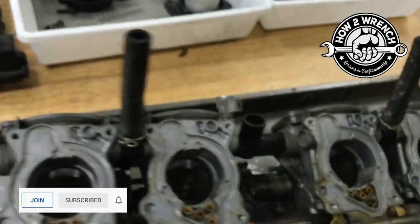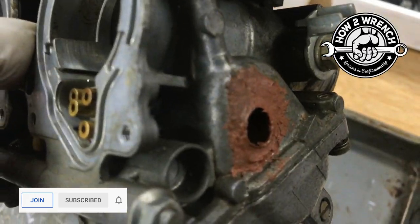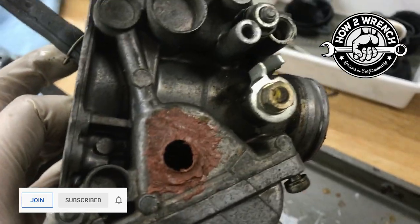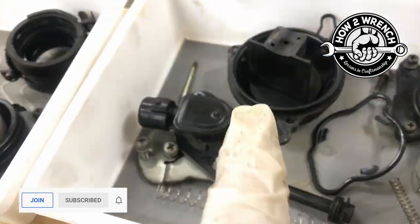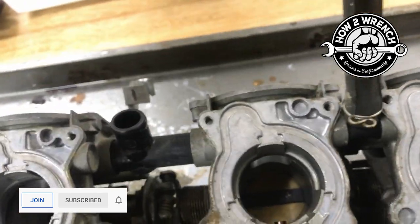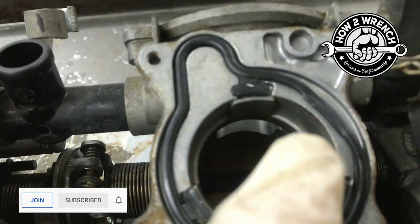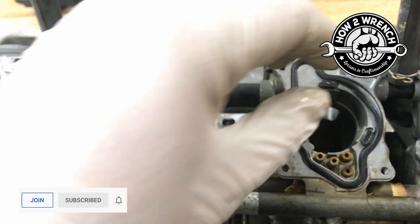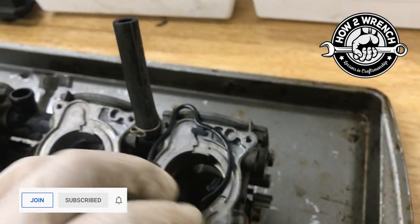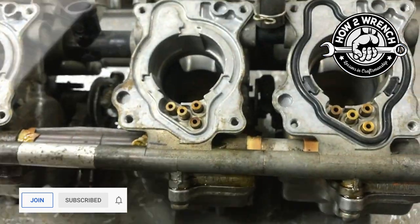Some other things when we were first tearing this apart — it had some silicone on it. On this side it's a pretty bad deal. You can actually see the float inside of there, and the piece that fell down in was the throttle position sensor. This just keeps getting worse and worse. This gasket was pinched over — three of them were perfect, nice and flat, but this one walked and somebody didn't catch it when they were installing it.